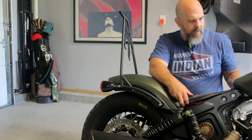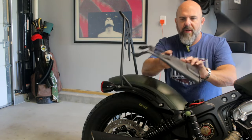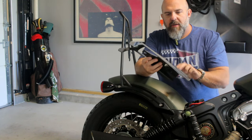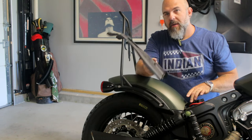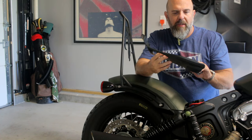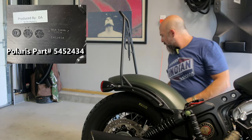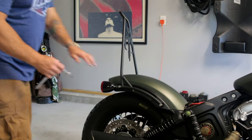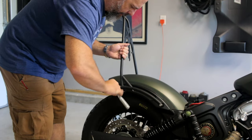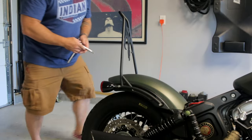Lift the tank up a little bit and this just tucks under it. This is the standard block-off plate for the bobber — you can get these fairly easily off the website. The one that we need you can't get really easily off the website, so I'll leave part numbers in the description for what all this stuff is, the ones I'm taking off and the ones I'm putting back on. Now to remove these — they're also six millimeter. Loosen them up for now because these four bolts hold a lot of stuff on.